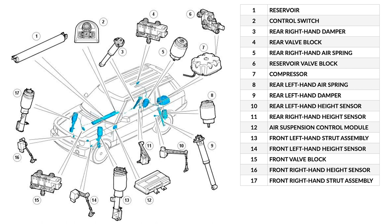and we'll know there's some serious splits. Now, we also shouldn't forget the air reservoir itself, which I'm now pointing to on the diagram for your convenience. This is also on my car, the original air reservoir. So it's 15 years old and has been sat under the car for the last 204,000 miles in all kinds of conditions. So we're going to whip out our spray bottle full of nice bubbles, get ourselves under the car and spray it down and see if we can find any air leaks.